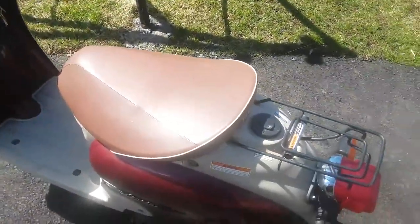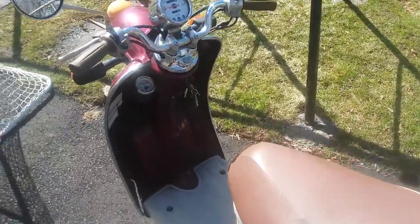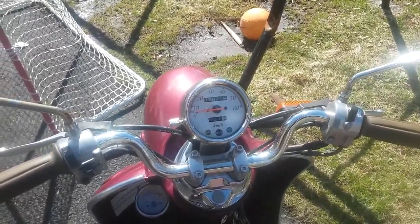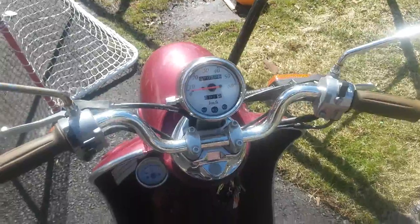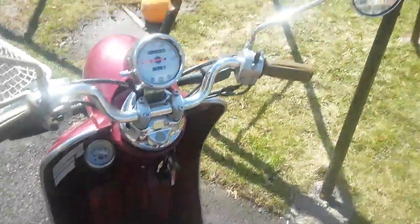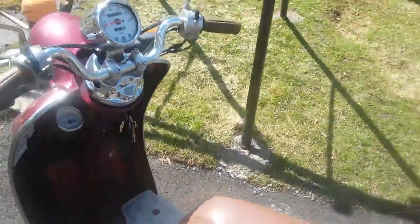These ones are two-strokes — pretty simple design. You get to the spark plug on the bottom. The battery is a special battery only from Yamaha dealers, costs like 65 bucks. The gas tank is accessible from the outside — you need a key for that. The oil tank you access by opening the seat and turning the screw on that cover — it uses two-stroke oil mix.